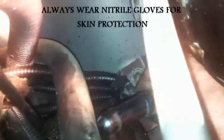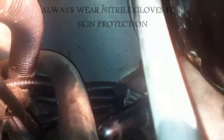As you can see, there's a couple of wire loom hooks here for the wires to go in, and they're not in them, so it's been done before, and it wasn't snapped back in all fancy like. So we're going to go ahead and fix that. All right, what's going on with this? Let's see, it's got these stupid click tops here. You can slide them out this way, really hard sometimes. I just grabbed that thing and yanked it one way, and it finally slid out this way and popped back. So, all right, which one's the one hanging here? This one goes right through the middle. Not that I think that makes a whole lot of difference, because this has been redone before. All right, now, if we're right, it should be this farthest one back here.